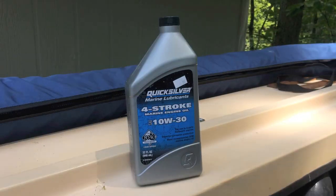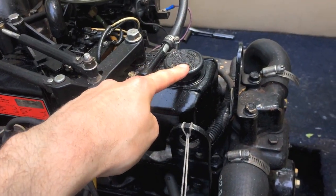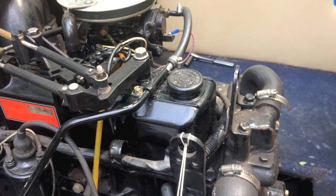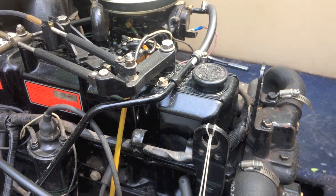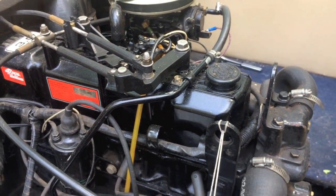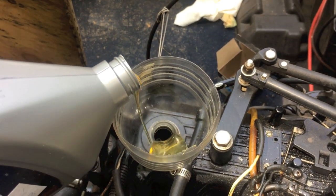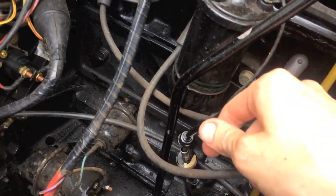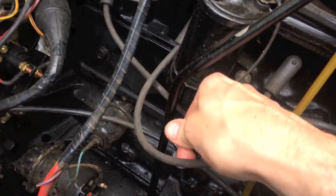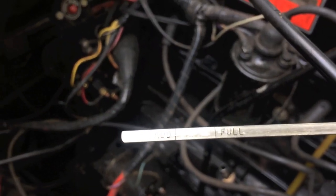We bought the Quicksilver four-stroke 10W-30. Let's go ahead and remove the cap and begin pouring it in. On average it takes about four to four and a half quarts — again, refer to your owner's manual. You do not want to put too much oil, so verify you're putting the proper amount in. I now have four quarts in. Pull the dipstick out all the way, grab a napkin and clean off the tip, put it all the way back in, then pull it all the way out. The oil is in there right at the full mark, so I'm going to stop at four quarts.